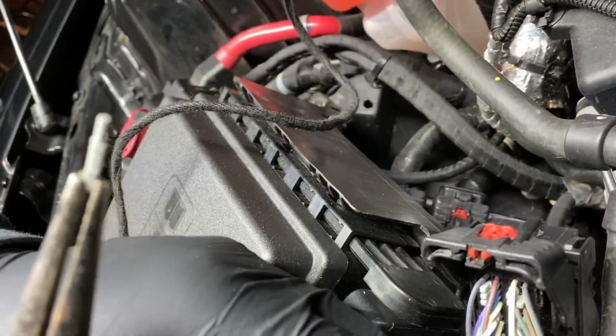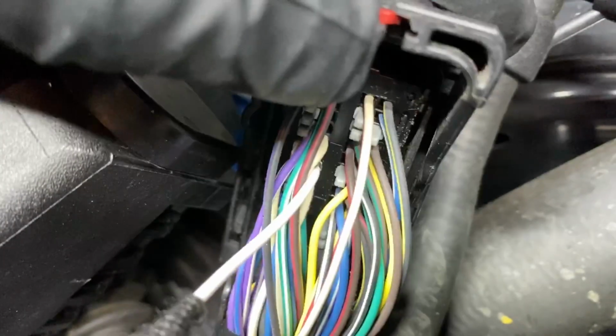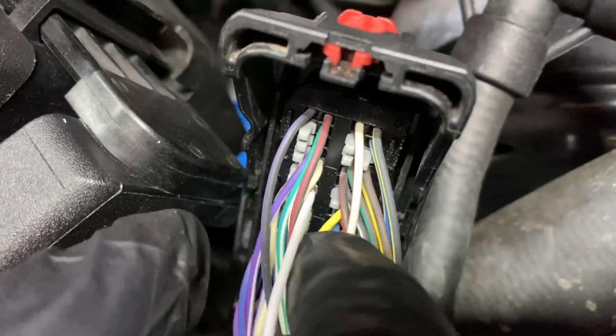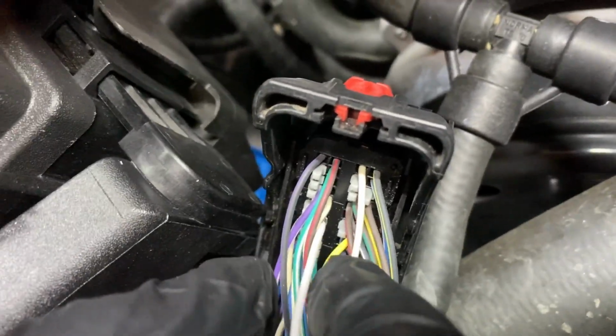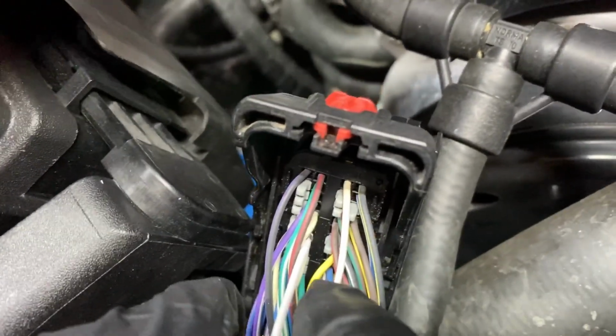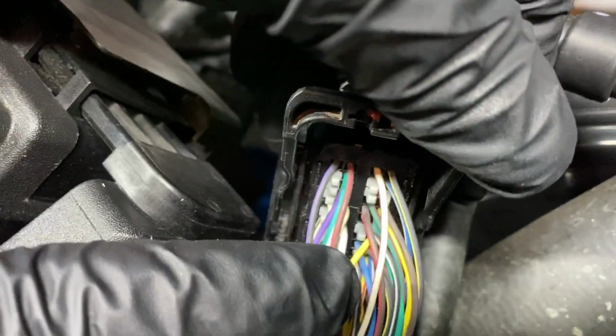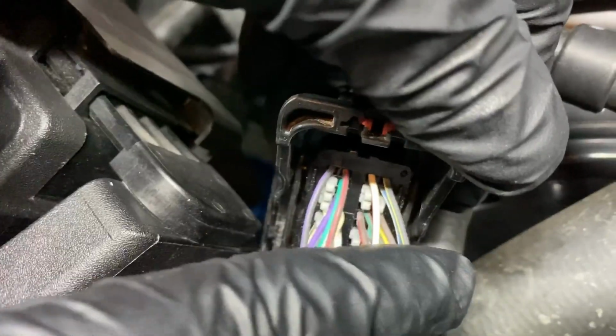Straight. When you get to 38, all you gotta do is pull this pin out. Just get some needle nose pliers, pull that pin out, plug in the flex fuel sensor, and now there is a special way to put it in. On the inside, where you can see the wires coming where they had to crimp it, that's the part you want to put facing the wires from the first 2 rows. And then you just pin it and go from there.